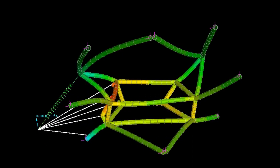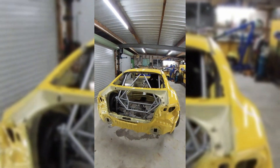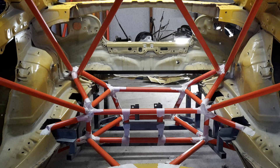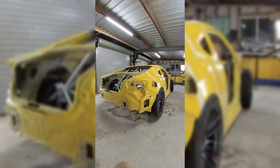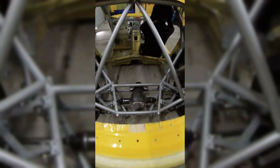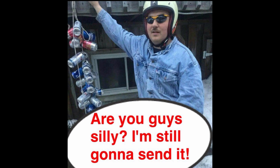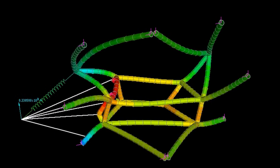I was lucky enough to do some FEA on this car with a friend of mine from the WRX club, Dave Benicki. I'd never done anything like this before, so it was a matter of reading books and talking to people. I basically came up with a design using some electrical conduits — a series of triangles, because that's what you want for strength. Once I was happy with the design and there were no clearance issues, we used a plumb bob to measure all the junctions in space. For half the structure — only need half because it's a mirror — I got all the XYZ coordinates, gave that to Dave, and he did the FEA to determine how strong the tube chassis design was going to be. Dave did the FEA, everything looked really good, and that gave me the confidence to go ahead.